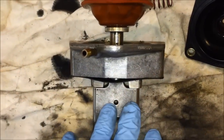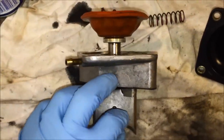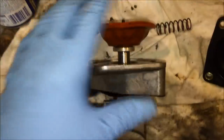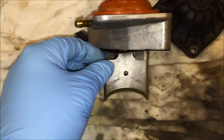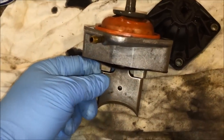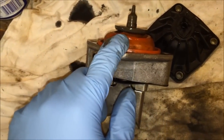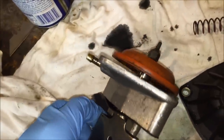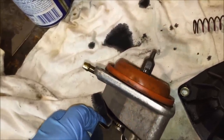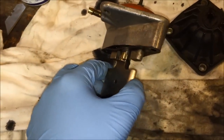If you do it incorrectly, the valve will spin and the bellows spins with the valve. If you put the cap back on in the wrong orientation and then try to spin it afterwards, what's going to happen is you're going to tear the bellows right off the shaft, because once that cap is on there it can't turn in that groove since it's clamped down.